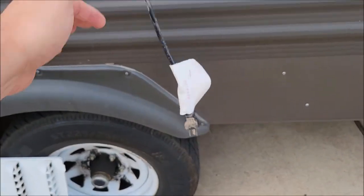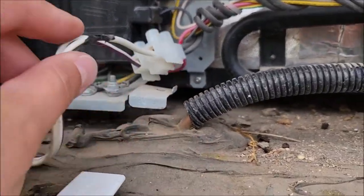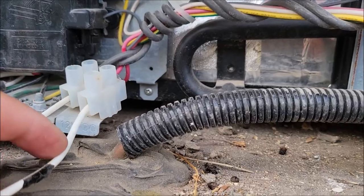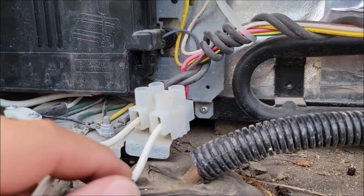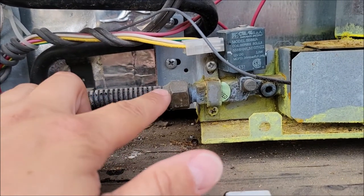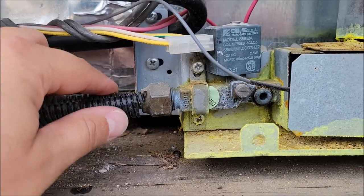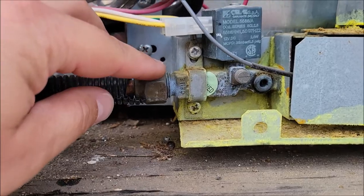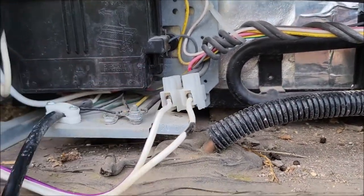To remove this refrigerator from the outside, there are a couple of things. One, you need to unplug the 120-volt plug — you'll usually have an outlet somewhere on the side. You also need to undo the 12-volt ends; this model has the wires right here. I always treat wires as hot no matter what, so I'm going to take these out one at a time and wrap them with insulation or put wire nuts on them. Then you need to unhook the propane. If you have any propane in your line, I would recommend turning off your propane, going inside your rig, and turning on one of the stove eyes until it goes out to make sure you've drained all the propane out before unhooking this. The three main connection points are: propane, 12-volt power, and 120-volt power.